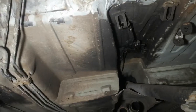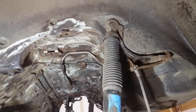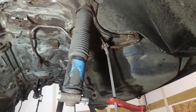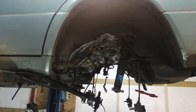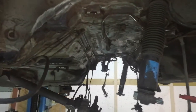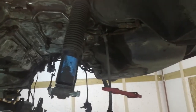So essentially what I'm going to do is tape off the body of the car and spray the whole area with a rust converter. I might do that before or after I've done the work here, anyway, and then over that will go the coating, whatever floor coating I go for. I think I might go for that epoxy if the budget will allow it. Yeah, it's a bit frustrating, guys, and a little bit tiring. In hindsight, it would have been ideal to either not go near this at all, or get the entire car blasted underneath. That would have been one option.